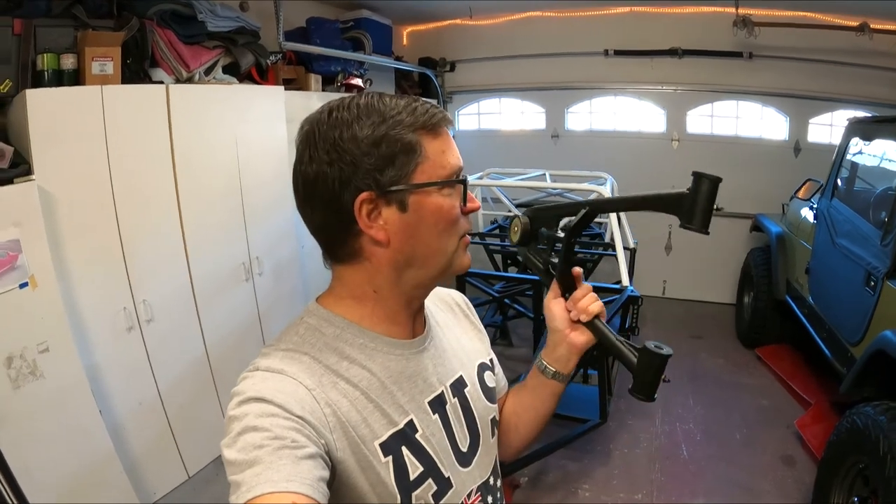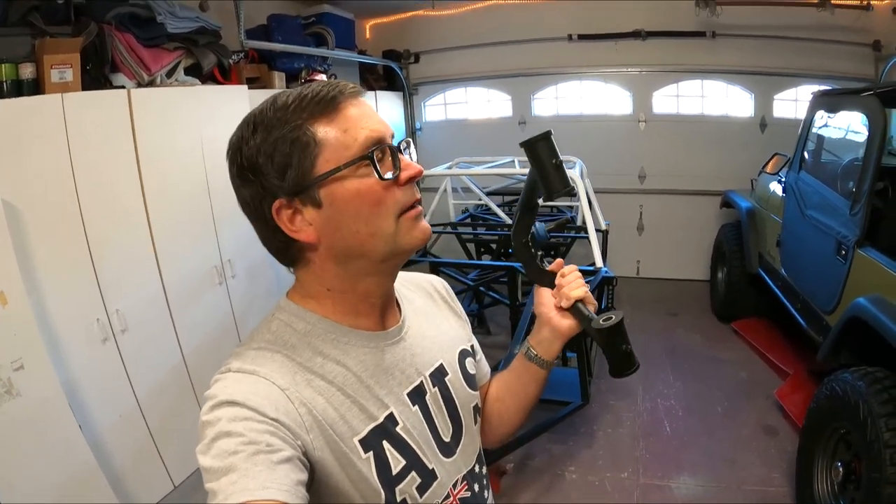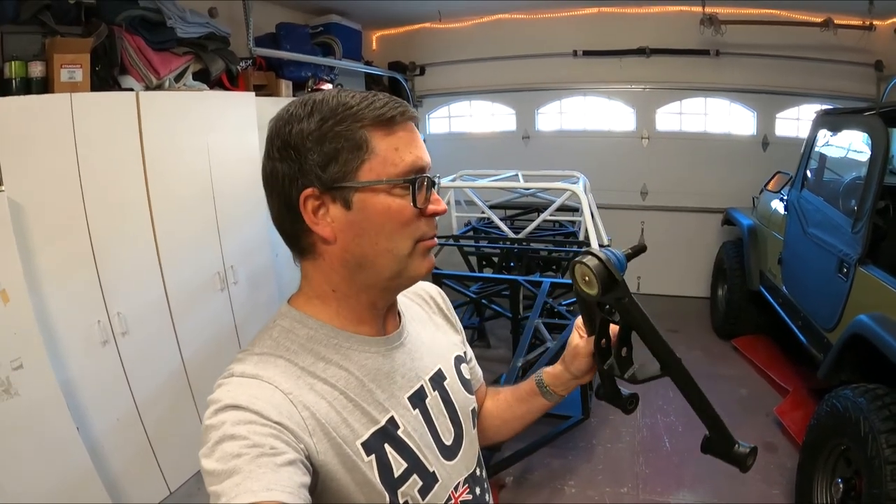I won't show a whole lot of the painting since you guys have seen some of that, but these things will all be white and looking good. So the first thing we're going to do is push out the bushings — that way I don't have to tape them off. We'll tape off the Zerk fittings, probably the ball joint, and then we can get these things scuffed up and ready to roll. Please hit subscribe if you want to see more episodes. Thanks and enjoy the Cobra Daytona build.